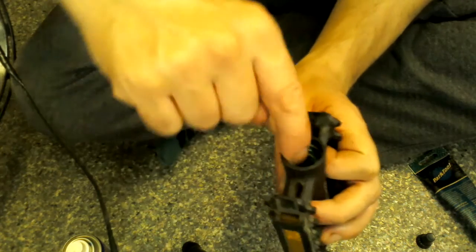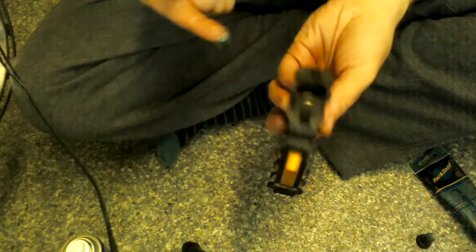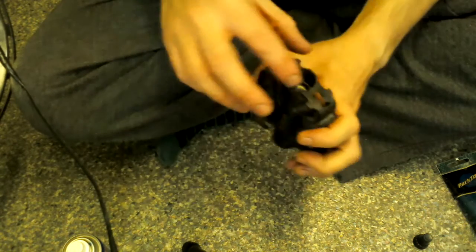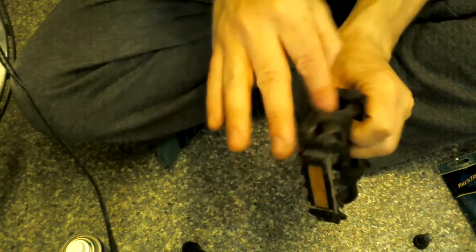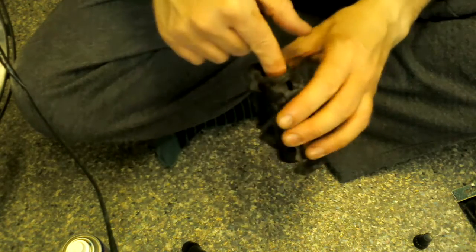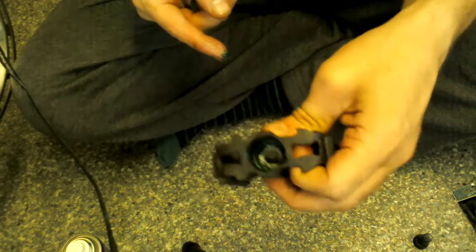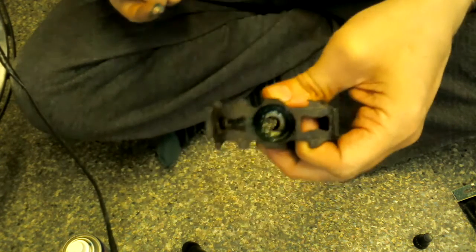and just run it around the inside of there. Not too much but not too little, just that'll do, it's fine. I've coated it now around the inside of there, that's great. Especially for your pedals, you don't really want too much because then they'll be too stiffened up and won't run that well. You probably won't notice when you're riding, it's not going to really mess anything up, but as long as you don't stick copious amounts of grease, there you go, some in that side, that's enough for me I reckon. That's just fine, as long as the bearing's got some nice grease to run around on.